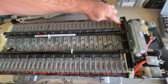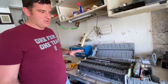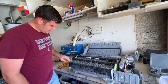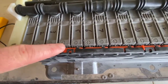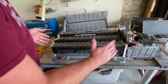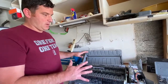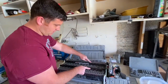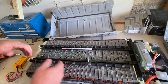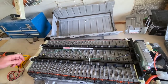All right, here it is — this is the battery. Now this is actually, if you look, a battery that is 28 individual batteries. They're called nickel metal hydride batteries. Each one of these batteries is connected in series — you can see right here there is a minus and then a plus, a minus and a plus, minus and a plus — so these are all connected together and this forms the hybrid battery that is used for the Prius.